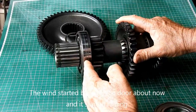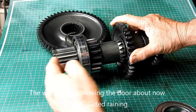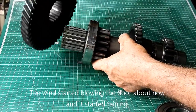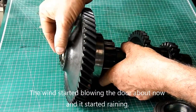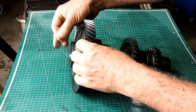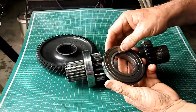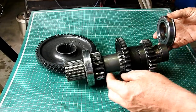We have a front bearing. You have the front oil seal housing here and a wall in the middle of the gearbox — that's where that bearing goes. This gear here sits up on there, held on with a snap ring. To get this shaft ready for assembly, this bearing goes on back that way with the circlip at the back of the housing holding it from moving.